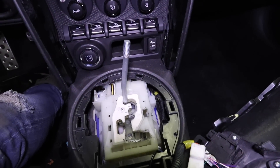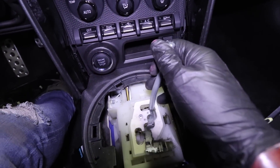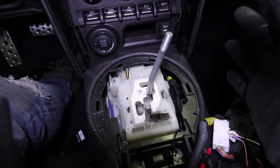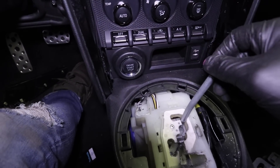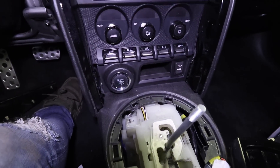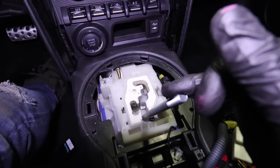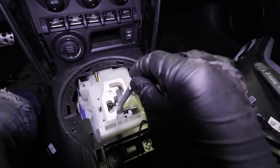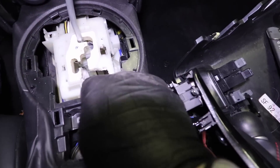I adjusted the lower connecting rod — it's now connected to the transmission and to the shifter. First try ever — did I get a gear? That's reverse! The pattern on the shifter is matching up with what's going on in the transmission. That's shifting out of park into reverse. One more down is neutral, then drive, then low three. We don't quite have enough real estate for low two yet — it's like we're halfway there. Drive, neutral, reverse, park — we're getting close!